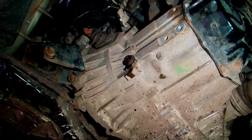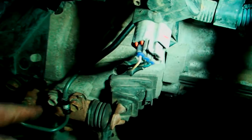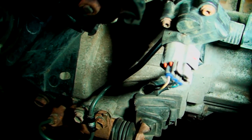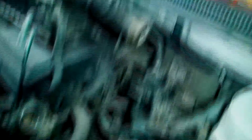Give that a bit of a squeeze and be careful with it because you can easily break it. We need to put the clutch back on, a few of the earth straps and stuff, and we're close — ready to start. We've just had an absolute nightmare with the clutch slave cylinder lining up the two bolts. I didn't disconnect the pipe, so I didn't have to bleed it. I pressed the clutch and it's moving and doing everything it's supposed to. Put the earth connections on. What I've got left to do now is put the two gear linkage cables on, the battery and the air filter, and we're ready to go.